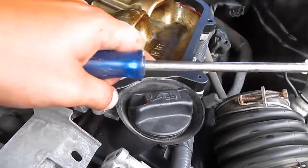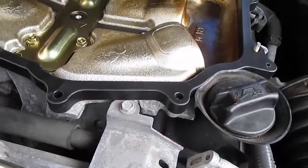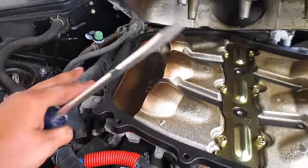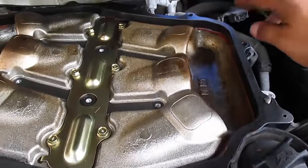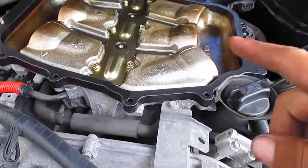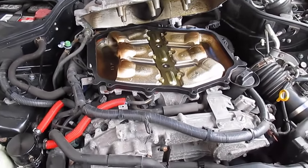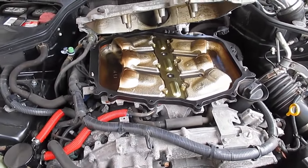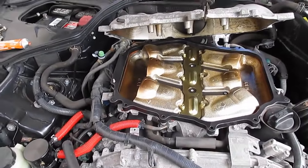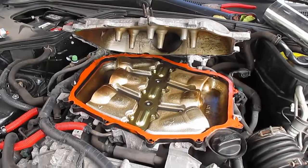The spacer goes right down without pinching anything for the oil. Everything is put down and looking pretty good. I'm going to add a little more gasket maker all around the top, then bolt this up, torque it to spec, and hopefully it runs.